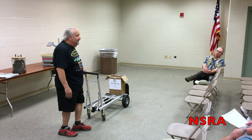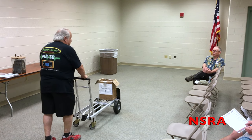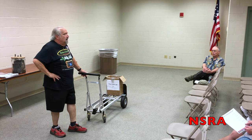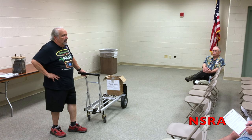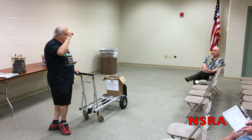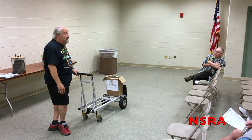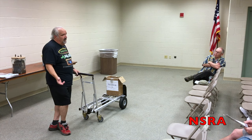What vintage is that last battery? I think that's about 85. That was either on a farm, one cell out of a bank, before we got power lines. They're 2 volts each, so you might put 20 of them together and wire them to your light bulbs and the things you run at night. You would have either a windmill with a generator on it, or one of those single lung pumpers that pumps away during the day while you're generating electricity, and you're running on DC.